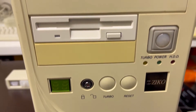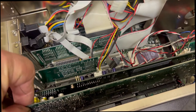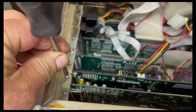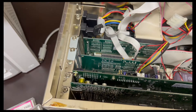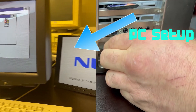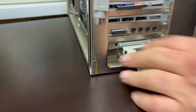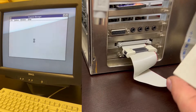This is the main board that's going to go in the PC. Let's get the card in — it just slots into a standard ISA socket, nothing special about that. This PC's got a full-size Sound Blaster card. It doesn't have a video output. This is a weird card because it's not a pass-through like the 3dfx or any of the other cards. This card just sits in the system and uses the system's power and resources, but it doesn't really use a lot of CPU power — it basically does everything itself, like having a console in the machine. There's no pass-through for the video, so you do need the standard VGA output.